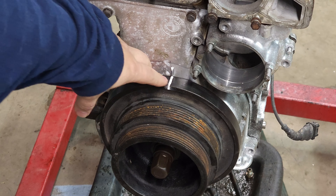I'm going to pull this pulley and cover back off so I can access my timing components. The timing tool kit that I bought off the internet has a tool to hold and lock the flywheel in place, but on my engine stand there is no room for a flywheel between the pins and the engine block. So I'm just going to be mindful of where my engine is and not rotate it — I'm going to make my own marking so I can watch the whole process as I go.